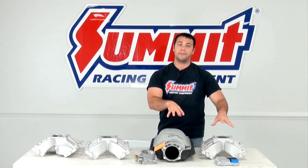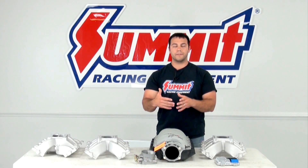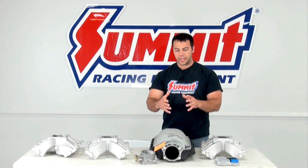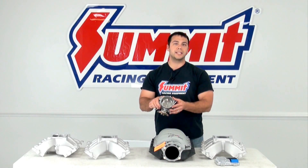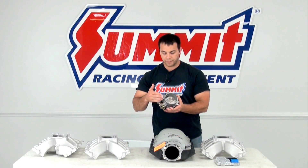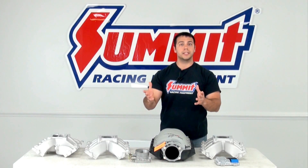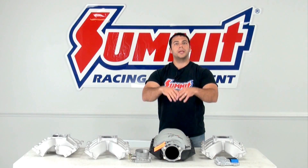If you choose to go with a fuel injected setup, it's a little more expensive. But as Dave mentioned in his EFI video, it gives you a lot more flexibility in terms of tuning throughout the entire RPM range. You also have things you can do to improve the airflow, such as swapping out for different size throttle bodies. This is a Trick Flow 80 millimeter throttle body. You can go all the way up to 110 millimeter throttle bodies, getting more air into the intake manifold, through the engine, making a little more power.